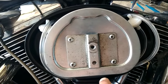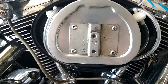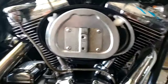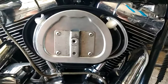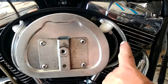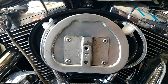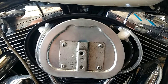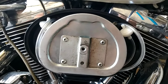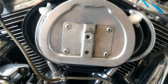I've just put this in and ran it for a little while, and I got water vapors immediately. So I'm going to keep an eye on it and make sure I'm not filling up and flooding out with water vapors too fast. But if you're watching this video, the water vapors have evaporated on their own and did not become an issue. You immediately get steam — within five minutes of running the motor you get steam on the inside of the clear lines. I'm going to ride it, put some miles on it, and hopefully there's a quick enough evaporation where water itself doesn't become an issue. Even if water accumulates in those lines, the oil will still be trapped on top of the water.